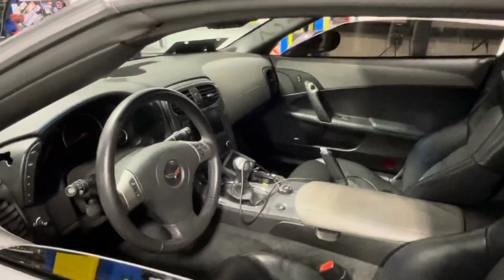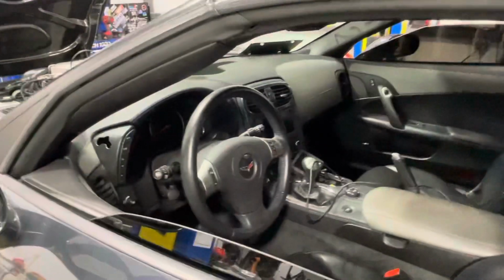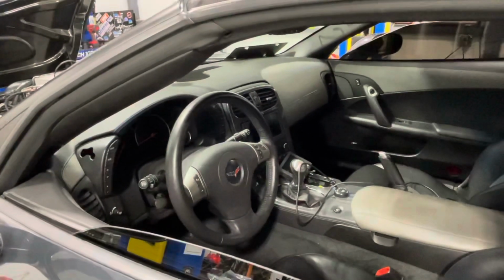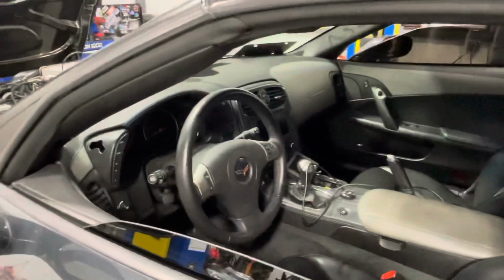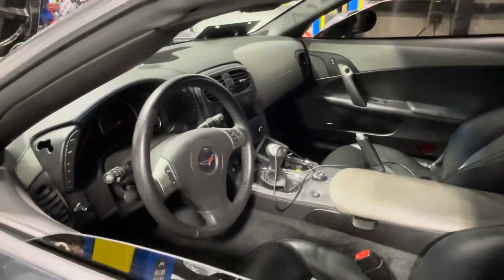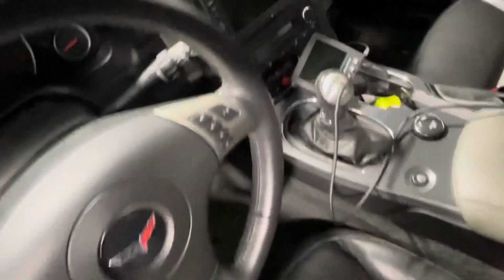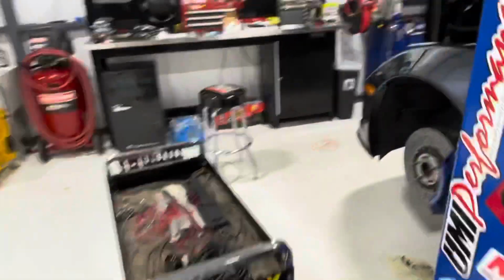I figured that out after having Kurt from ProEFI on the phone with me, helping me check wires for continuity, power and ground. Big shout out and thanks to him for helping me, even though it was my own idiotic doing. Once we got that up and running, I had another issue where we had power but no CAN communication with the logger or the CAN cable. That actually turned out to be a little problem with the kit.